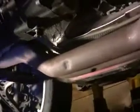Again, you got them over here on the side of the transmission crossbeam, and then you got them up front above that crossbeam where the motor is, okay? So now notice that we got pretty much dual exhaust. We got 2 pipes that are coming all the way down here. Got 2 catalytic converters. We got 4 oxygen sensors. We got these resonators, and then it joins in the back over there where the muffler is. So just something to take note of.